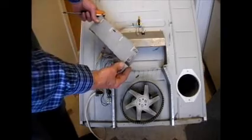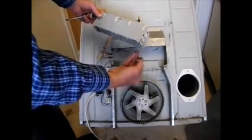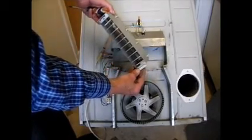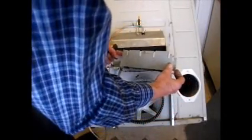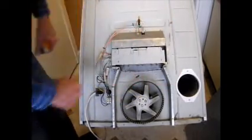Remember which way round your porcelain connector goes — there's a slot on it, and the rounded parts on the ends of the slot go inside the heater unit frame, like that. Then you can push it back in. If you put it in there, you can then slide it over — that seems a bit easier. And you have to work it in on the other side like that. There we are.